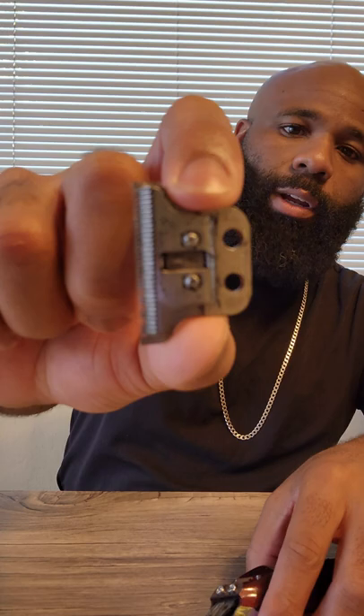We're going to start by removing both of these screws right here. Don't mess with the stuff up in there or you're going to make your whole clippers fall apart. All we need is this blade to come off. Once we take it off, the hard part is making sure that we zero gap it and make sure everything is fully level, otherwise you could injure yourself pretty good - and we don't want that. So make sure you watch the video closely. I do believe I've actually recorded this one other time, so if this video doesn't give a very good explanation, I'll try to add that other video to the card that pops up.